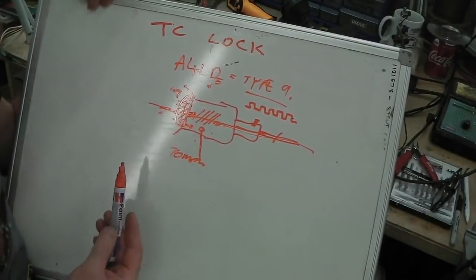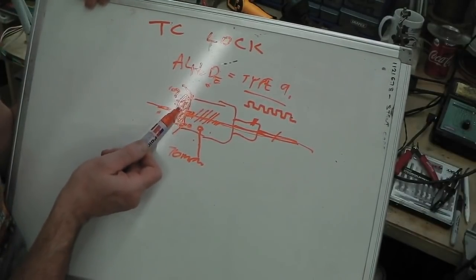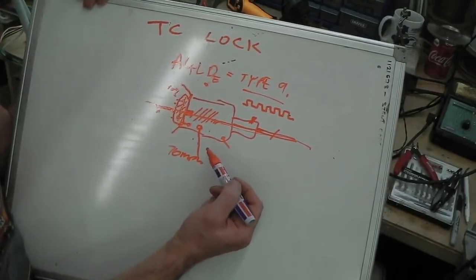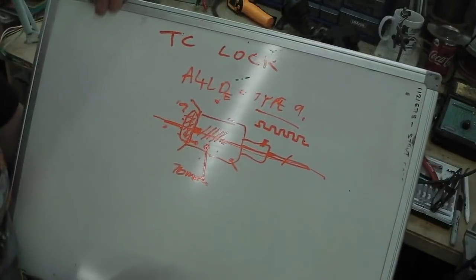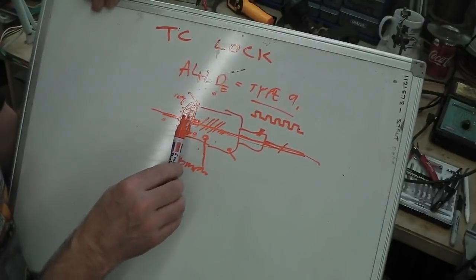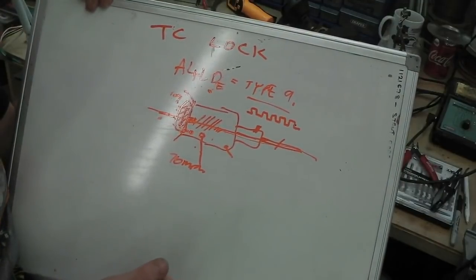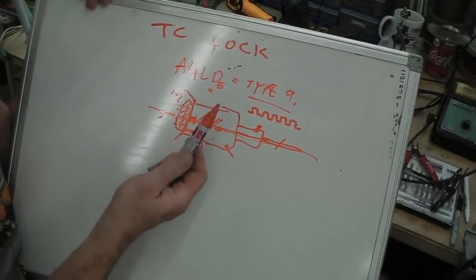So if you're pulling up to the lights and coming stationary, you don't want this on, because you'd stall your engine, because you'd be solidly locked. Although I do believe that the gearbox actually overcomes that in a hydraulic valve sense. I don't think that's actually possible to do, but in theory, if you didn't turn your lockup solenoid off when you got to the traffic lights, you would stall your car, because you'd have no torque converter. It'd just be like being in first gear or fourth gear, whatever, in your manual car, not pressing the clutch in until you just stall. So it has to be controlled at the right point.